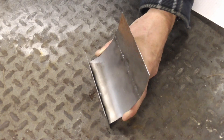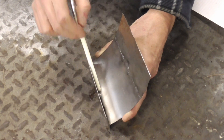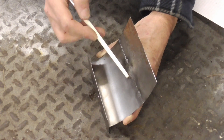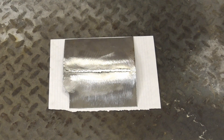On the inside, as we drive the car, moisture enters the panel through window gaps, hood and fender gaps, and so on. The water or salt water runs down the panel, settles at the bottom, and hopefully drains out and dries inside. Up at the seam, moisture can find its way into imperfections and quickly begin to bubble the finish, and the outline of the repair will eventually begin to show. There are many times you will have to butt weld, but there are ways to do it that eliminate issues, remain consistent, and have longevity.